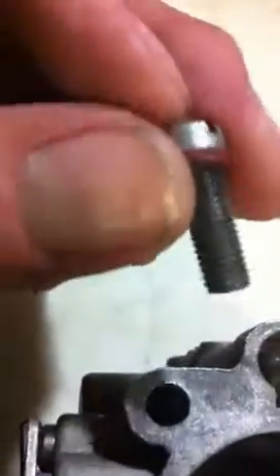This right here is what you call your low speed jet down inside of there, and this is your set screw for it. It has a washer on it too. Make sure that the screw is in really good shape and make sure it doesn't have any dirt in it whenever you put it back in, because that's going to be down into the carburetor. You just tighten it down snug.